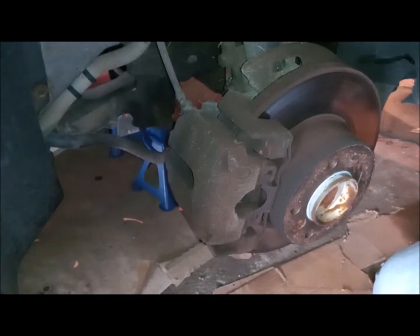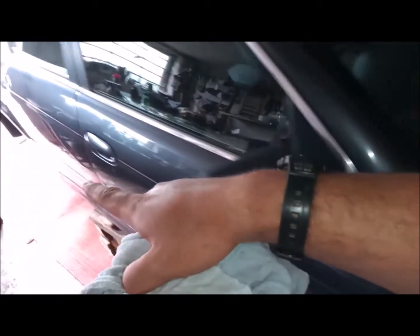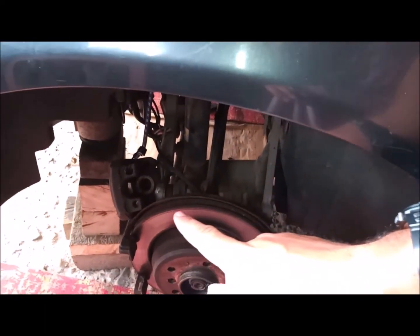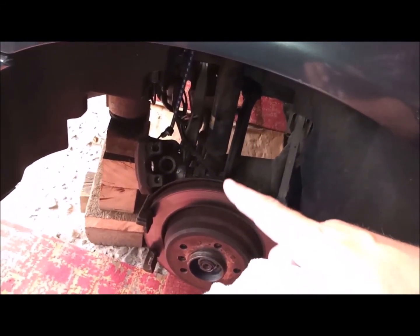I'll just open it. I'll go of course to the front tire now. I finished the back tires. Of course, if I've started with this position, my reserve is there, I will start with the wheel that is farthest from it, which is on the right rear side. So I start with that one, as you see here. The lines from the reserve up to this tire are all depleted, which means almost 70% of the oil in my system is already out, which will make the process easier and shorter when I move to the other tire on the rear side, and then the front, the opposite side of the reserve, and then next to the reserve on the left side.